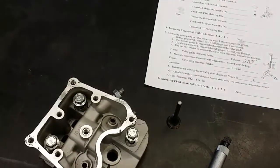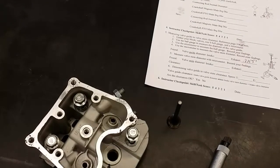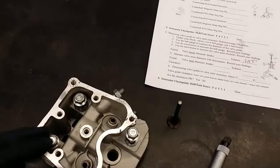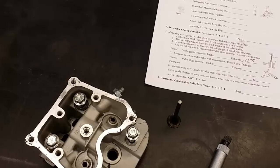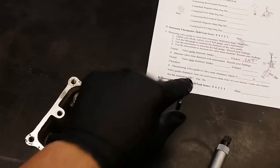I'll go ahead and write that down where it says valve guide diameter for the exhaust. In the case of our engines, the difference in diameter from the guide to the stem — what's known as our valve guide clearance — can be right around or just under 0.001 inch on many of the engines. So it's imperative that you measure to the nearest 0.0001 inch, otherwise you might find that your guide and valve stem appear to be exactly the same diameter to the nearest thousandths, which can't be since one fits into the other.